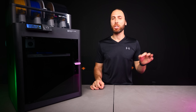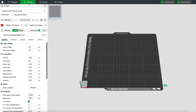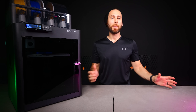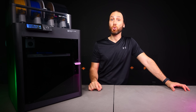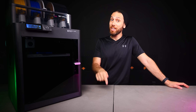Both printers feature a full, albeit plastic, enclosure. Both have approximately the same print speeds and performance, at least on paper. The Creality even has a touchscreen going for it, and previously had the ability to jailbreak to a full open-source Klipper experience — though they've now patched that with a software update. But it's in actual day-to-day usability where the P1S really pulls ahead. The app, slicer, and printer management software are leagues ahead of Creality's restricted, buggy, and spammy software suite. Most reviewers — myself included — have had problem after problem with the K1 under-extruding, and its first layers are far from perfect. Since recording that video, I've yet to do a single print on the K1 that wasn't interrupted by a thermal runaway error. There's no camera, no compatibility with any material switcher, the overall build quality isn't as good, and the build volume is smaller. But hey, the touchscreen is nice, and at $599 the K1 is actually priced the same as the P1P.